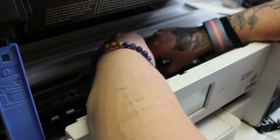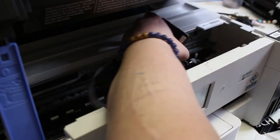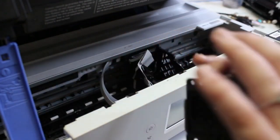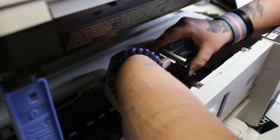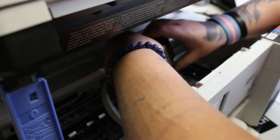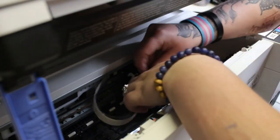Here I'm trying to push that bigger FFC cable from out of its little holder place behind that. For me it was easy to grab a little bit of pliers or something, just to grab the actual print head itself and lift it up out of the carriage, since it's a little stuck tight in there. Here's the print head — we will then go ahead and replace it. Now we basically just want to follow our steps backwards again. We're going to go ahead and put the large FFC cable in. I have the print head upside down because it's easier to do that way. Then flip it and let it sit back in there. If you need, you can get the pliers again to grab it and just situate it back down flat.